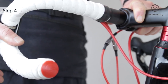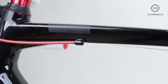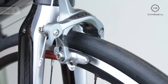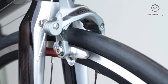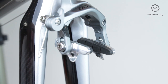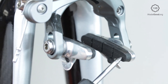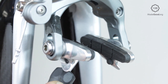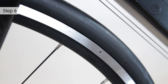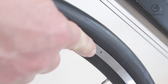The outer cables need to be free from splits or cracks. The inner cables must not be frayed — check for broken strands inside the lever and where the cable is clamped on the brake mechanism. The blocks need to be held firmly and must hit the rim and not the tyre. There must be enough material left in the blocks to comfortably last the duration of the proposed trip. The rims also wear away when used as a braking surface — some rims have a groove to help diagnose the point when they need replacing.